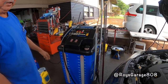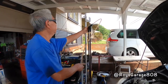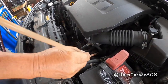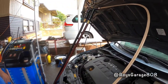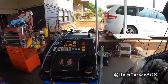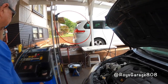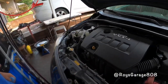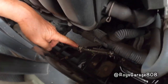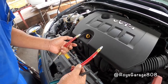I'm going to be using this transmission fluid exchanger. I'm putting in four quarts of transmission fluid just to get started, putting this tube right into the transmission dipstick tube and pumping in four quarts. Now I'm going to be connecting my machine to the transmission cooler line — I can get access to the cooler lines from the top. I'm going to put these fittings in-line and connect them to my transmission washer.